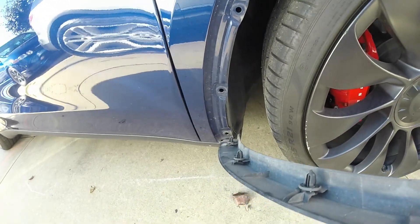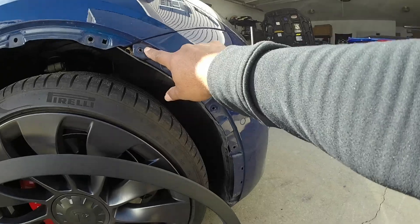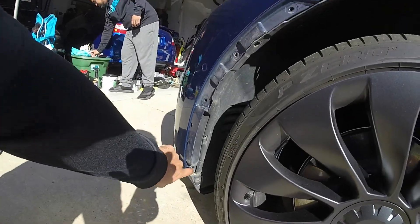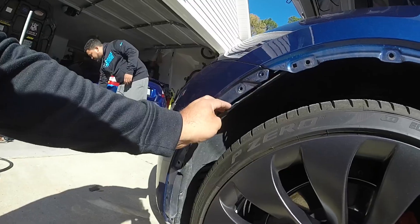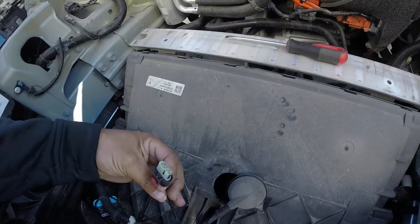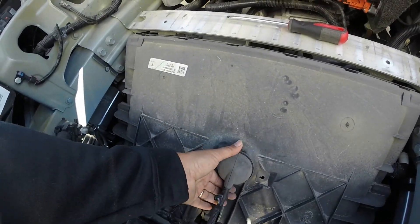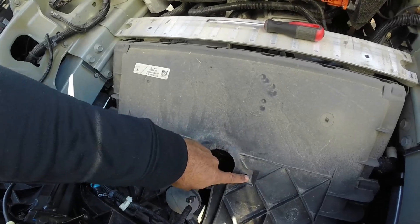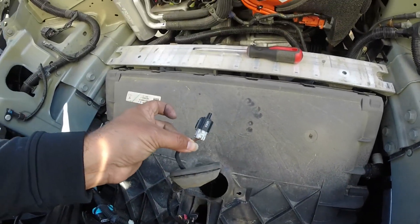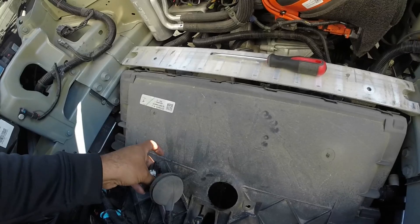The last one is held down there — you need to pull it down and then out. There's one screw hole in the bumper right here. On both sides we removed the retaining clips that hold the fender liner to the bumper. Then in here we disconnected the air flap connection and the temperature sensor. I used a plier to push the divots in and slid out the sensor, but we're just going to leave the sensor hooked up.